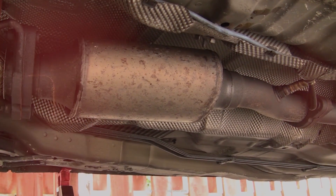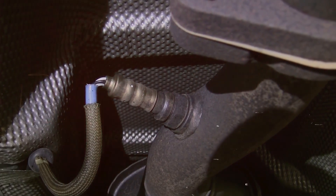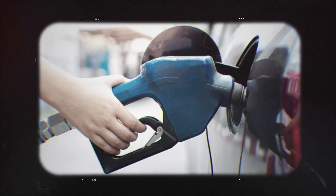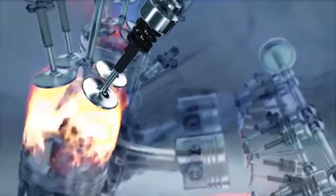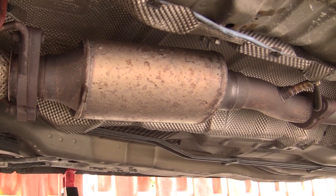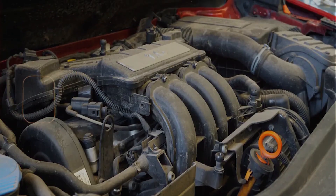So what's going on here? The O2 sensor's job is to check how much oxygen is in the exhaust and help the computer balance the fuel mix. But if it's stuck lean, it's like it's always saying give me more fuel, even if everything's fine. That can mess with how the engine runs and how clean it burns fuel. Bank one means the side of the engine with cylinder one, and sensor one means the upstream sensor, usually right on or near the exhaust manifold.